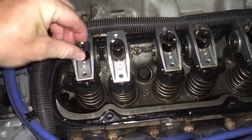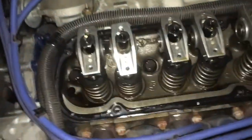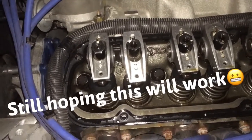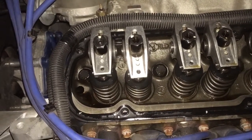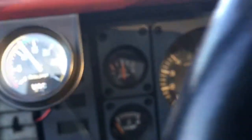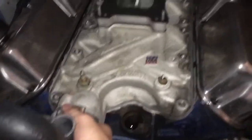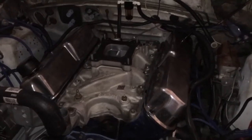I'm tightening the adjuster nut down while using a wrench. I would go down two turns past zero lash, bring it back up, let it swell up, and I'm doing that over and over again hoping to exercise this lifter because I thought I had it fixed but I haven't fixed it yet, and I don't want to pull the intake. I'm driving to work and look at the vacuum gauge — I can bounce it like crazy. I overdid it on the preload on that exhaust valve, so I'm going to have to drive it home and fix it. Breaking news: I'm taking the intake off and we'll see if we can figure out what's going on with this lifter.